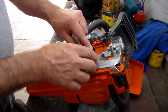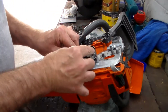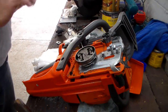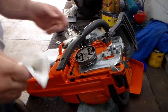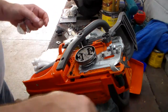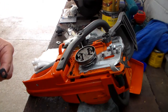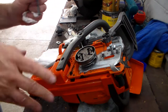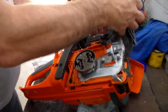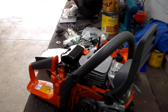Next comes this little clutch — you can tell that's not the side we hit to get it off. What we do notice is it's threaded backwards: I'm turning counterclockwise to tighten it. You really don't have to make this super tight, because when you pull that cord to yank-start it, it will tighten on its own. So it's not necessary to beat it tight. Alright, here's my part. Let me get things out of the way — I'm going to flip this back over, take the cord out of here, and see how it goes back together.